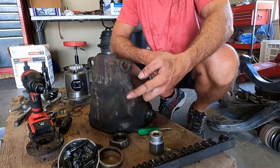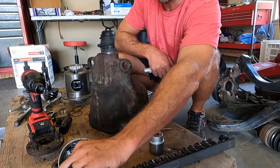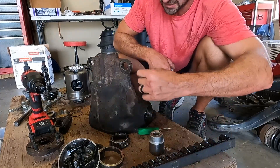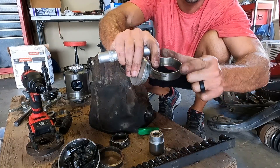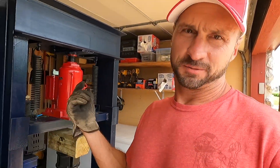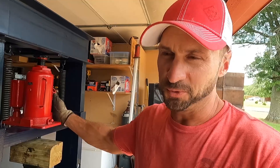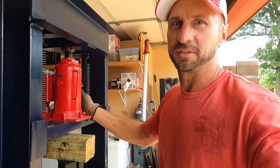I'm not going to be a knucklehead and stick an old bearing in here with a washer and something to try to drive that race in, because all that's trying to do is expand the taper, which will create more pressure on the outside and make it not want to seat. Needed to borrow a press, so we came to my friend Doug's house. There are a lot of tools you don't necessarily need to own — you just need your friends to own them. The other ones you can rent from the parts store, but a press is not something you use enough unless you're making a living at it or you've got the space and money to have one sitting around.